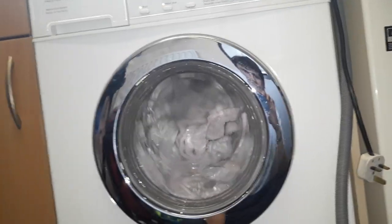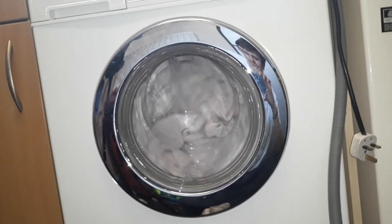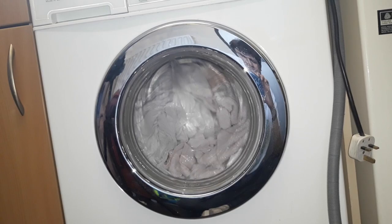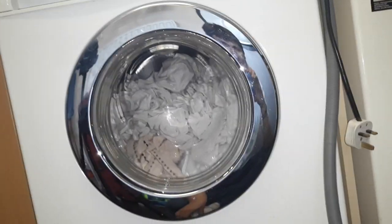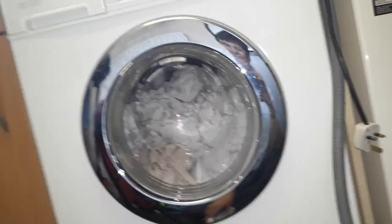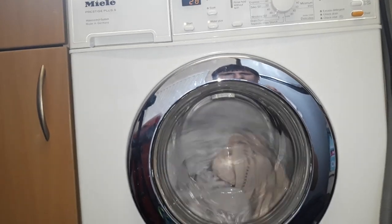We're on the second extra rinse — it's not a default rinse. The laminated brushes haven't worn down in this machine in 10 years. Probably within the next couple of years I'm near it — that's like 12 years with the same brushes. Hotpoint ones are about 2 years. These are half worn down, but when they were fitted the motor they weren't brand new — they'd already been used.